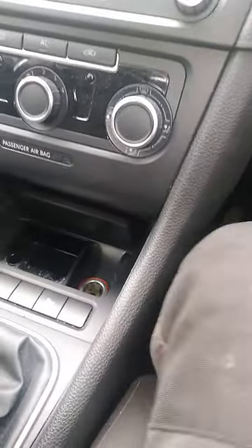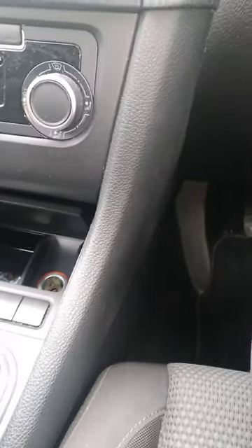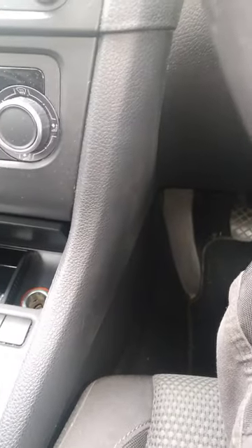So now we're just going to check for the basic problems. The first thing I'm going to do is go underneath and check if the master cylinder is wet or leaking, because that would cause air to be drawn in, which will cause the pedal to stay down and not come back up. I've checked the master cylinder from the clutch — it's all dry, it's not leaking.